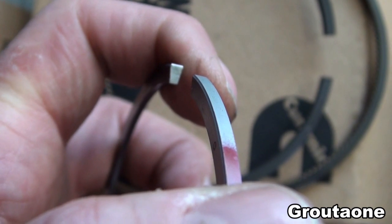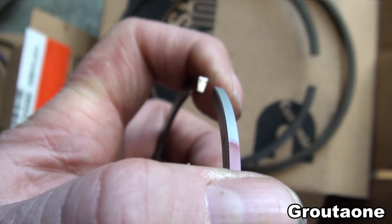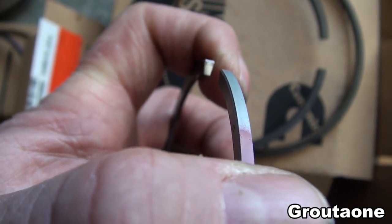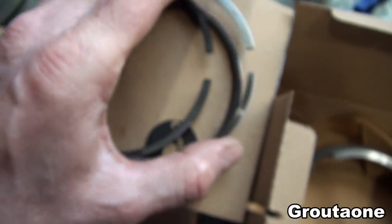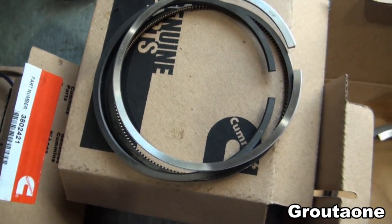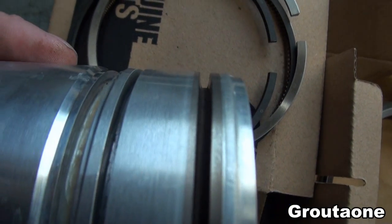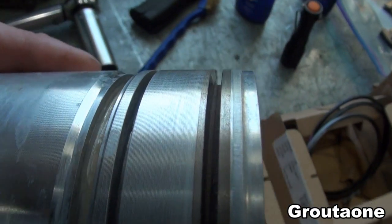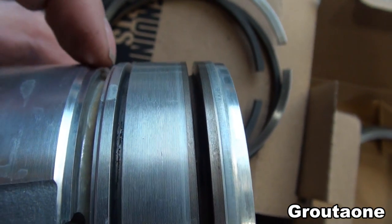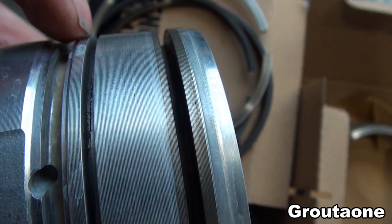This is the upper compression ring and it's actually tapered — I think it's visible on the camera. It matches the piston as well, which is also tapered. This isn't the one that goes in the block, but here's a piston for example. Maybe that taper is visible on the upper groove. The intermediate ring does not have a taper as near as I can tell, and it's not as wide either.